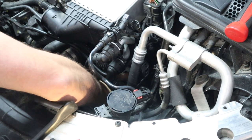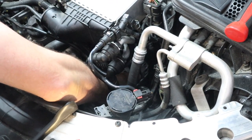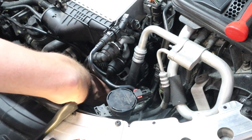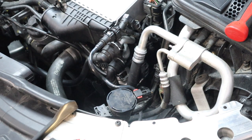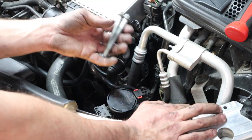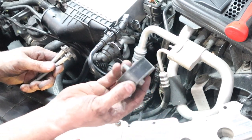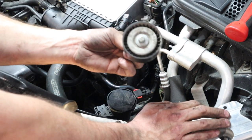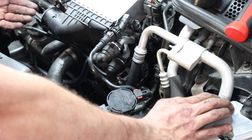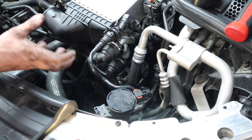Just rock it back down into where the holes are. These bolts are 3/8ths — a 3/8ths 6-point will take off these bolts. There are only two bolts and then there's the idler that goes on it; the idler is also a 3/8ths bolt. Once you take off the two bolts and the idler, you'll see exactly how the alternator just slides up out of place. Those two connections on the back are going to take you a little while, but once you get the hang of it, you saw I put it back together in a couple minutes. I'll show you the tensioner and how that works.